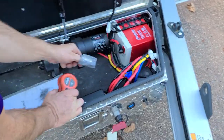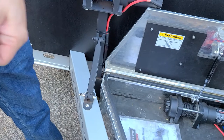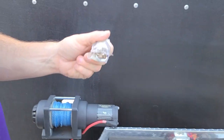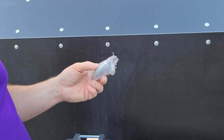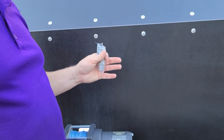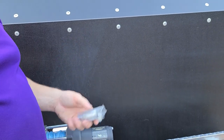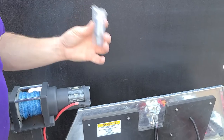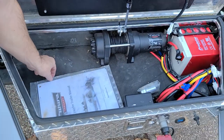Here is a socket — it's basically for your wheels. If you want to torque them down, this one's already been done so you don't have to worry about it. They torque at 98 foot-pounds. I usually set my torque wrench at a hundred. And you have a socket right there. Of course you also have a manual right here.